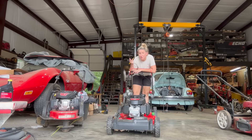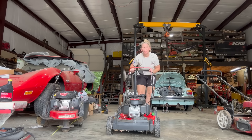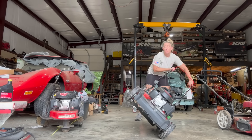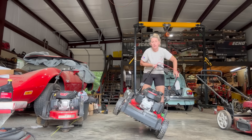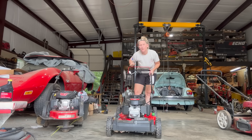The third most common reason I see at my repair shop why a mower is smoking is because somebody turned it on its side. I see this a lot with pressure washers too, when people have them in the back of their truck and think they can lay them down. Absolutely not. You never, ever, ever turn a mower towards the carburetor side when you're looking underneath the deck. You can turn it towards the exhaust side for a little bit, but if you're going to go for an extended period of time, you want to make sure that the piston is at top dead center.